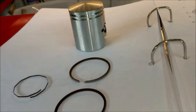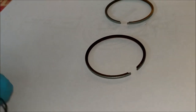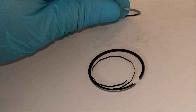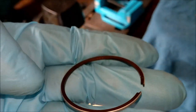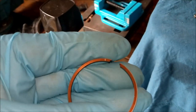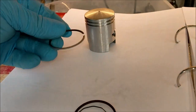Let's take a little look at this piston. You've got an arrow on the front there that points down. Here are the rings - there are three. There is ring one and ring two, and this little spring ring goes inside the bottom one. Now these are called keystone rings because the top surface is chamfered inwards and the bottom surface is just flat.